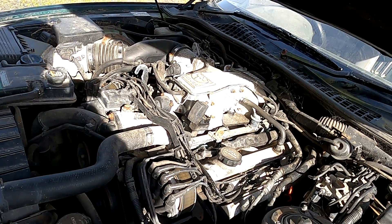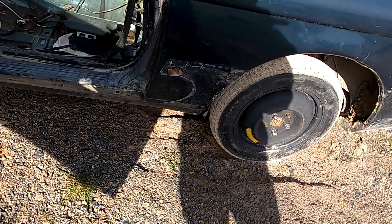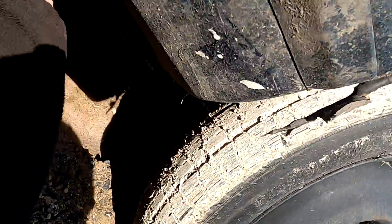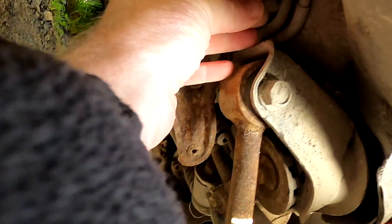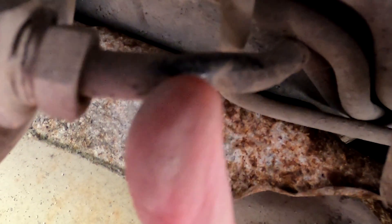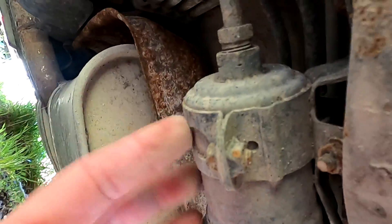So this is the old Soarer. It's non-traction. The body kit's gone. Here's the fuel filter - that's where the fuel filter is hidden, so make sure you change that when you do this job. There were some other nasties right here - you can see it's taken a big knock. It's had something come up and smack it and crimp that fuel line. That's something we spotted when it was up in the air, so that is an issue. This one has a genuine Toyota fuel filter on it, so it may have never been changed. That's not a good sign.